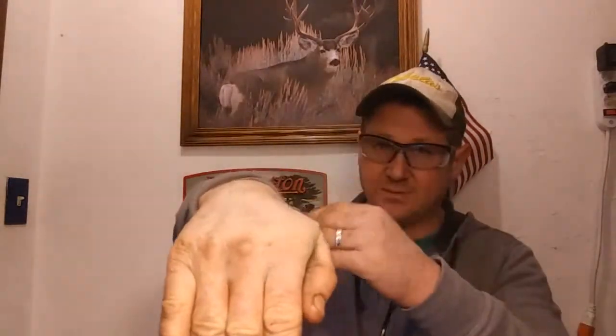The unit pumps kind of pop because they're under spring pressure, because there's a cam lobe that pumps them, and there's a spring, so they might pop loose a little bit on you, and you're going to have to hold that molded harness against the block out of the way so you can pull it up out of there.